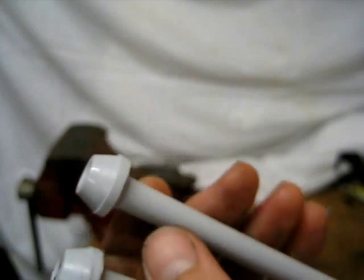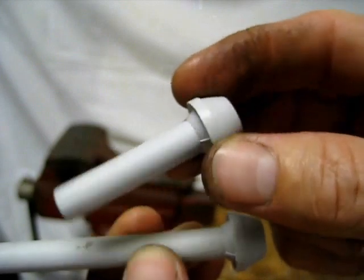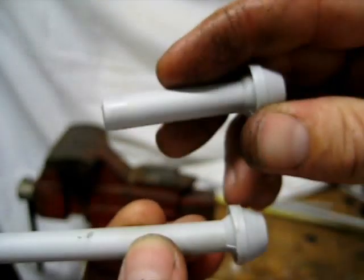Like I said, you're going to need two of these. One of them I'm actually only going to use a very small amount of — just kind of as a stopper at the lower end of my upper cable latch system. You'll see in a little bit what I'm talking about. I'm just going to chop it off anywhere. For the upper one, I'm going to make it a little bit longer — say maybe six inches or so. The reason for that is because when you're coming from that upper latch, I want my brake to be in an area where the cable runs straight, not in a curve. The lower part's got a curve and it's a little bit of a bind. I need from this end all the way down to here to be 31 and an eighth in my case.